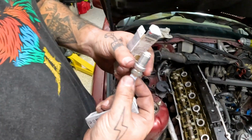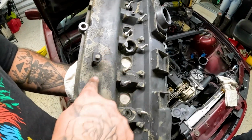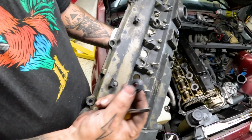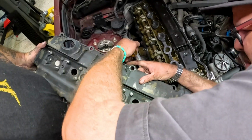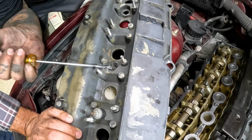All right, so the valve cover gasket is off, and it doesn't look clean, but it's been cleaned. We do have to remove all of these, which go underneath the nuts that go on the top to tighten down, and replace them with these nice new crispy ones. Not supposed to be hard plastic. Pitch black, like entering the void.